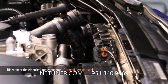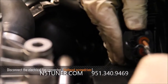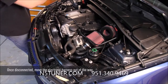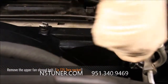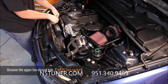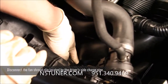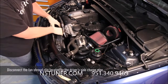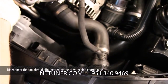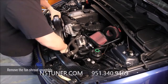Now we're going to remove the electric fan. First, disconnect the electrical connector right by the fan shroud. Once it's disconnected, move the electrical harness out of the way. Remove the upper Torx bolt on the fan shroud using a T25 Torx — this is the only actual bolt for the fan shroud; the rest use plastic tabs. Also, there's a small plastic tab on the charge pipe on the intercooler that must be disconnected from the fan shroud. When you remove the intercooler it should disconnect itself, but make sure it is separated. Then remove the fan and fan shroud assembly from the car.